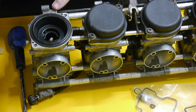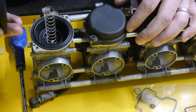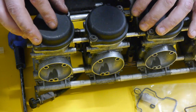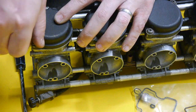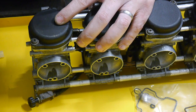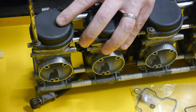Just remember if you're on the 750 model to change the little ring here, but as I say it's not on the 600. Get the spring cap put in place — this can only go on one way around too, there are little locator pins here and on the other hole. It doesn't have to be over-tightened.